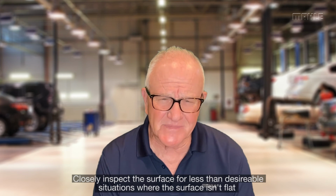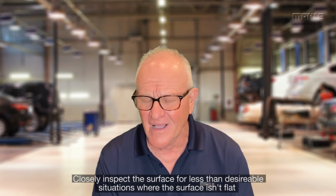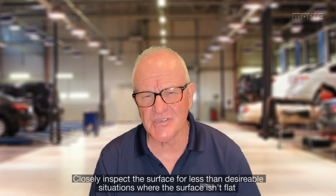So spend some time, whether it be a water pump or a cylinder head or an intake or a valve cover for that matter. Look at it, clean it carefully, and make sure that when you go back in, you're the last guy that has to go back in, because chances are the first one failed for reasons other than original equipment installation.